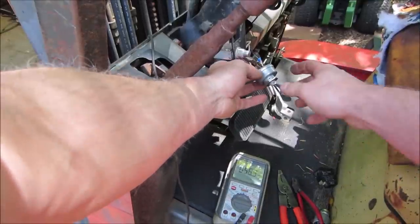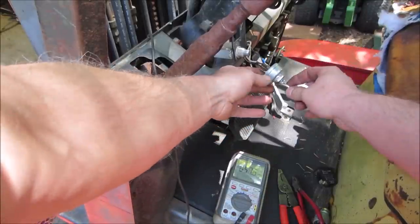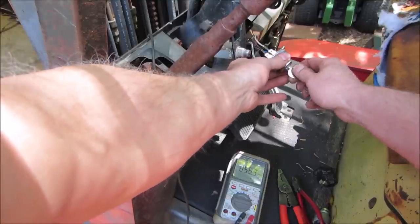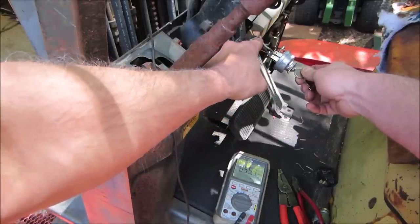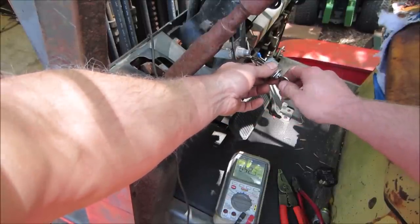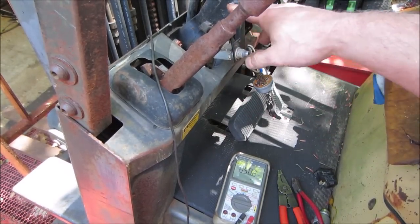After a bunch of screwing around I just went and got a new lawnmower ignition switch. That old one is no longer hooked up. We have power coming in on the white wire and power goes back out in the on position. Right now we've got power going out to the ignition for the coil, and if you crank a little farther you get more power coming out for crank. So run - you can hear the meter running - and then crank. I'm going to put it back in its original spot.